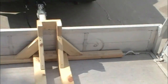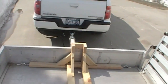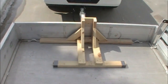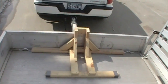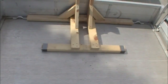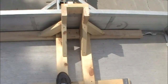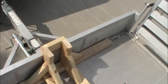There's a three-foot board at the back, and then two boards running perpendicular between the front and back that are two feet long. My tire was a 17-inch tire, 120 millimeters wide — about four and three-quarter inches — so I measured that slot for the tire to about four and three-quarter inches and it fit in very nicely. Then there are two upright boards at the front of the trailer, each about 12 or 13 inches long, with a brace board across the front to make them more secure so they can rest on top of the trailer.